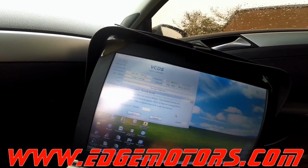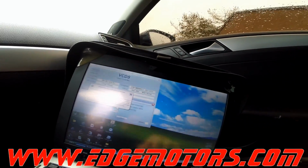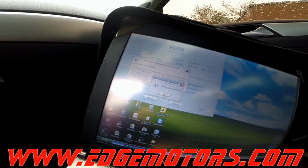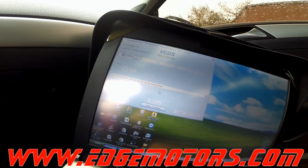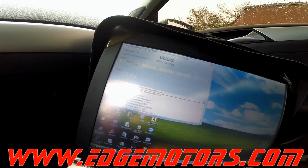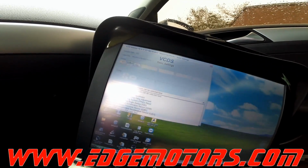Number one, we'll go to security access. You type in 40168 to activate the basic settings. See, the control module accepted our login. Go to basic settings. We have some drop down menu over here, but the basic settings that we're gonna do right now are not in this list.